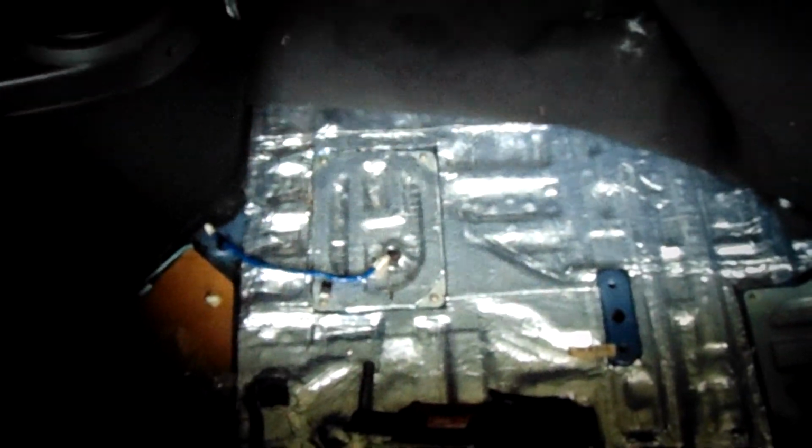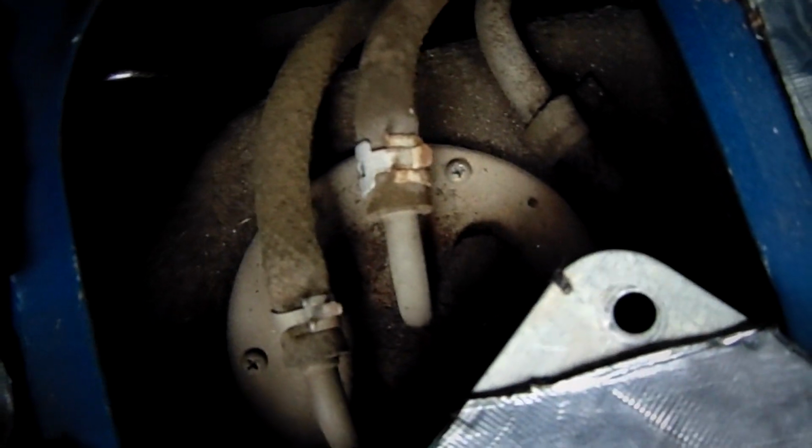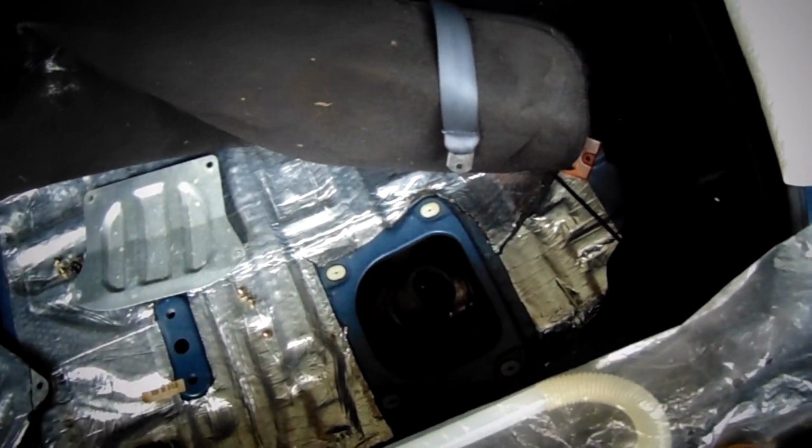I'm sick of sucking on that and eating gas fumes, so I'm just gonna siphon it out from the pump, from the fuel sender. So take that apart, and yeah. Actually, you know what? Those are Phillips heads, and I don't really want to strip them and cause a bigger problem than I already have. So I'm gonna see if I can go through the fuel feed, or from the filler neck. I got this handy dandy little jiggle pump, which I'm gonna try and use. Hopefully it fits in there, and there aren't any restrictions further down.